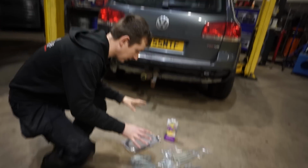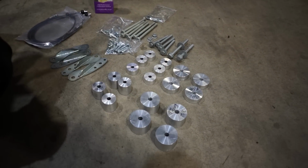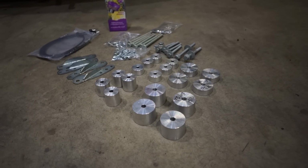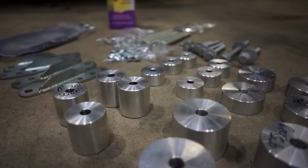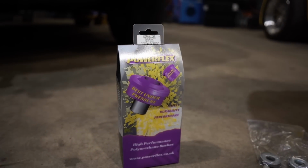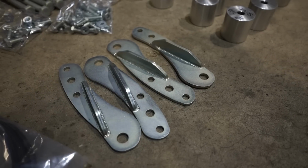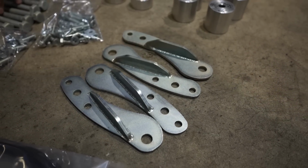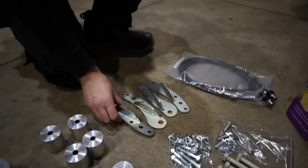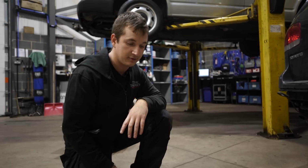So this is our lift kit that we make, pretty straightforward. To be fair, these are just bushings, basically, machined from aluminium, nothing too fancy. The biggest part that took a little bit of working out was exactly how long we could get away with it and how we'd do it. Other people do make these sort of things, but this is what goes on the bottom strut. We do ours a little bit differently to what I've seen, trying to stop them bending. But I've had no grief with them on the V10, so really happy.